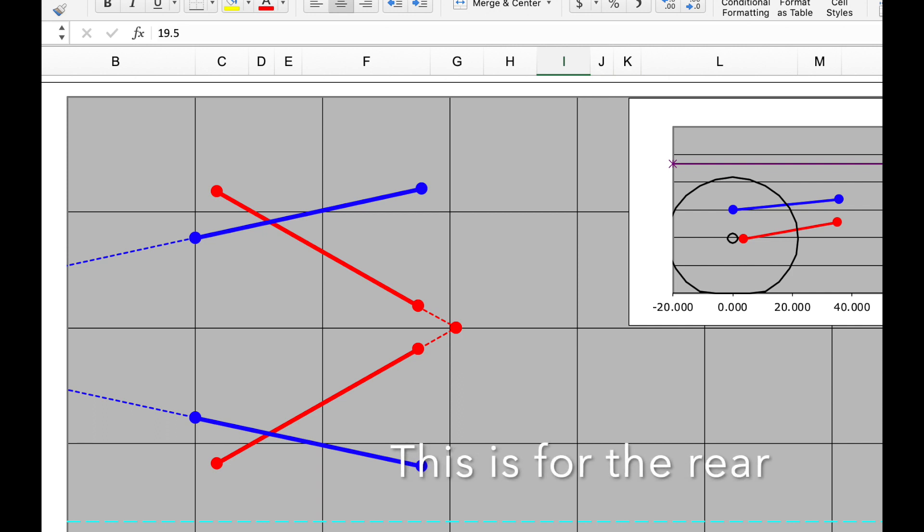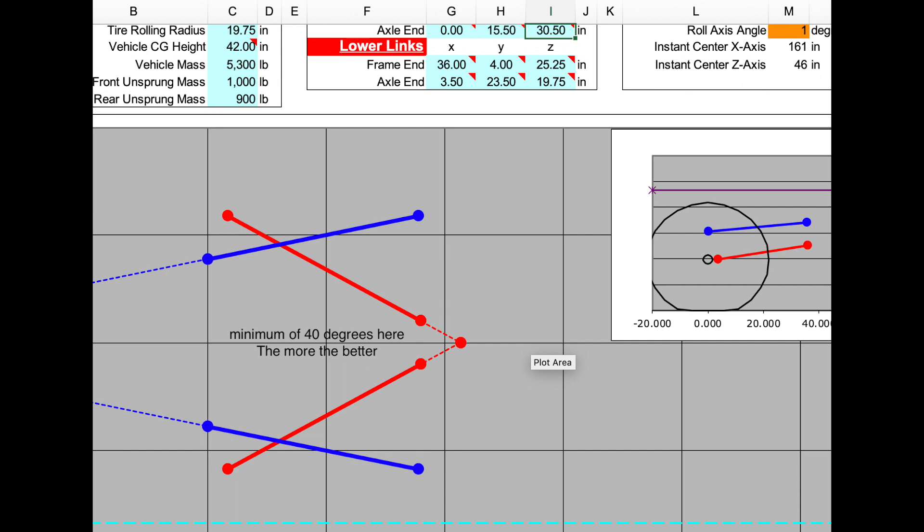As you can see in the picture I'm showing, this is how my 4-link front and rear look — they're pretty much identical from a top view. You can see the lowers are triangulated with very good triangulation, and the uppers are also somewhat triangulated. I tried to triangulate them as much as possible, but the large center section for the Rockwell differential limited my options for the uppers. The other golden rule I follow is to have at least one set of links — either uppers or lowers — with approximately 40 degrees of angle between the two links when viewed from the top. This allows the joints and suspension to handle strong side hits on the tire much better.